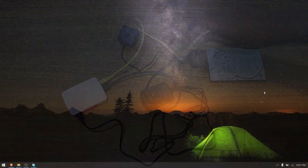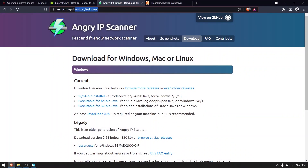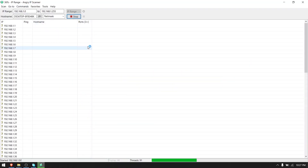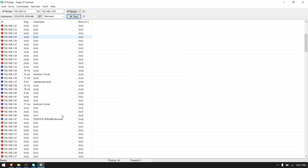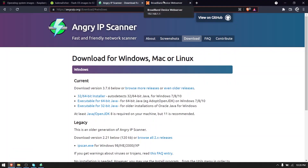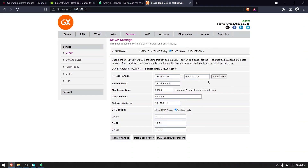Now let's plug in our Raspberry Pi and go back to our PC. Go to the link given in the description and download Angry IP Scanner. Install and open Angry IP Scanner, leave it at the default values, and press the start button. The scanner will scan your local network to find the IP address of your Raspberry Pi. You can identify the IP address of the Raspberry Pi with its hostname. The next step is to go to your router settings and assign a static IP address for the Raspberry Pi, or else every time you restart your server, the IP address will be different.